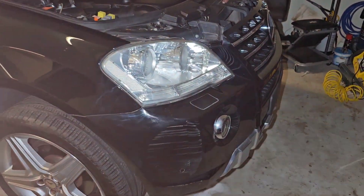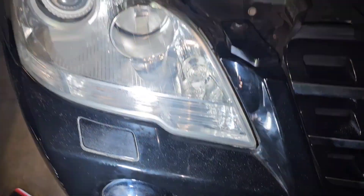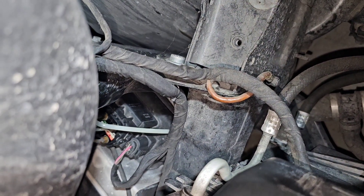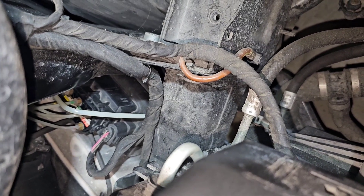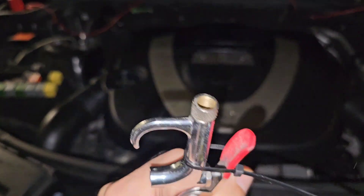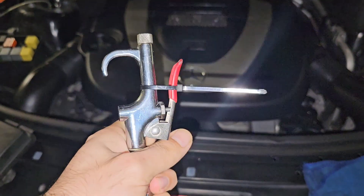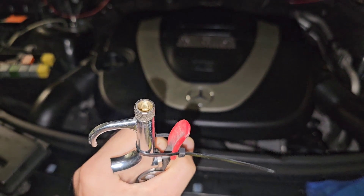If you have a W164, go to the right hand front fender at the front just below the headlight, and go back just beside the radiator. There you'll find the valve block on the left hand side of yourself and right side of the car, with the compressor underneath. I checked this by removing the right rear valve block hoses and used my air compressor with a special fitting to put pressure inside the rear airbags, but they couldn't hold any pressure.